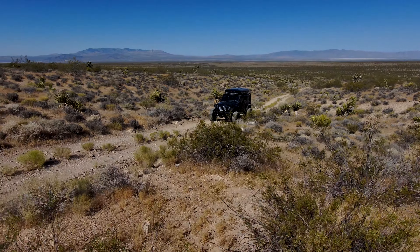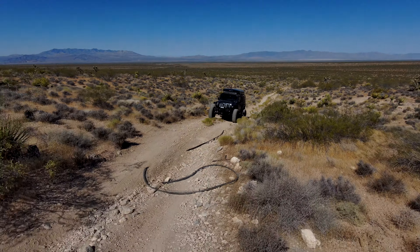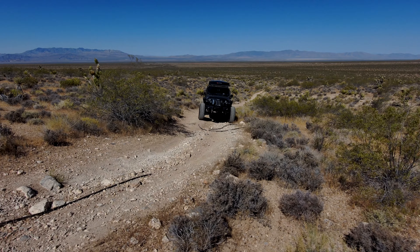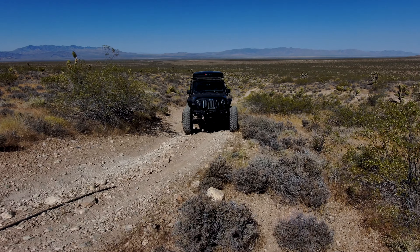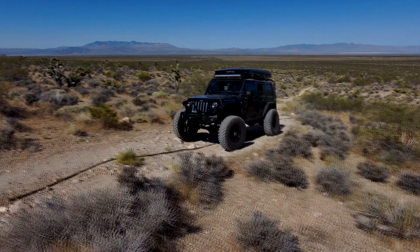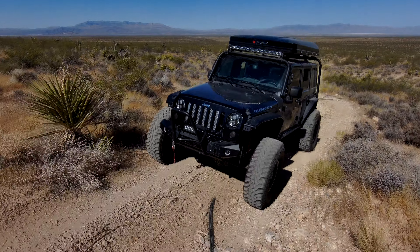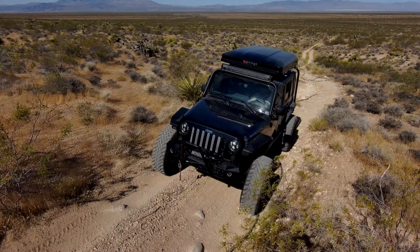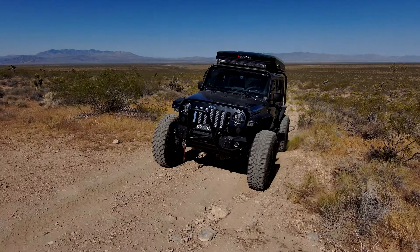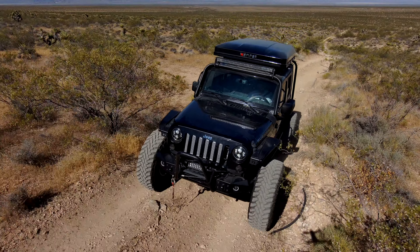There aren't many engines that could pull this kind of weight with this kind of drag, low-stressed. While the Hemi and the LSs are both aiming for horsepower and drivability, GM and Chrysler approached it differently. Chrysler still uses their speed density system, while GM uses a lot of technology — direct injection for higher compression, continuous variable valve timing. Stepping up to the 8-speed transmission was a big bonus for both manufacturers. GM has now stepped up to a 10-speed.